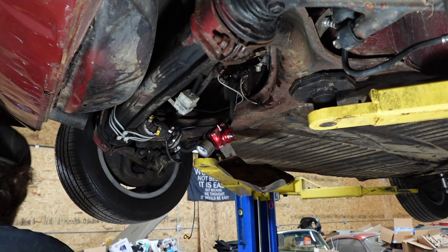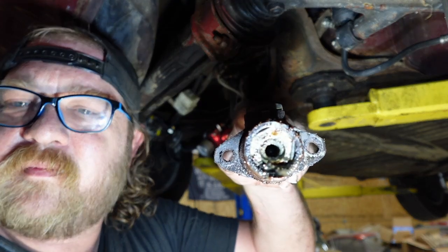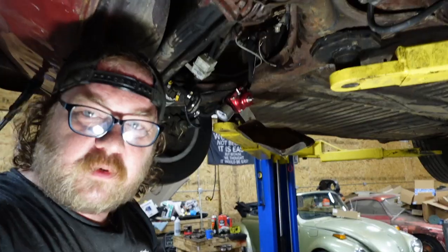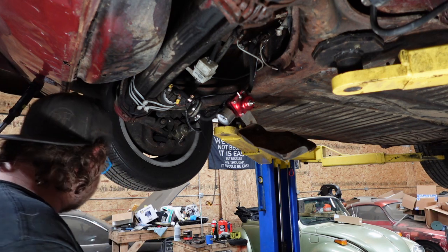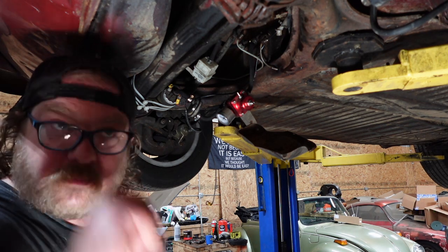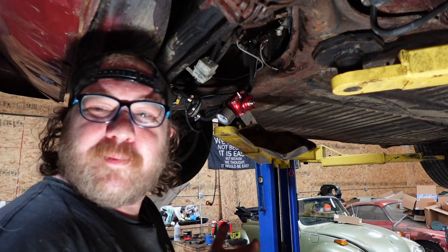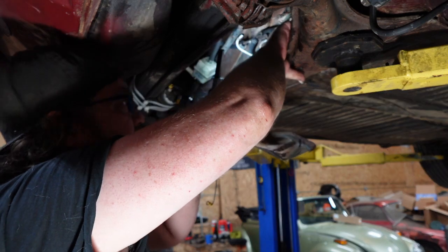And it's weird. It's so weird because, focus. Yeah, that's not the healthiest. Really surprised it was working. But yeah, that's why we're going to be replacing this thing. Like I said, I did think initially the leaks he was seeing were just the soft lines leaking. Upon further inspection, that's a lie, obviously. But what it's doing, like typical Beetles, if your cross member's wet, usually it's leaking internally. Yeah, that rod's wet too. All right, that's cool.